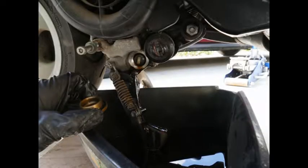Next, changing the tires. While the front tire is pretty easy to take off, the rear tire requires dropping the exhaust, and removing the exhaust is a minor nightmare. It's very hard to access the 10mm nuts — it's very easy for them to drop down and fall into the bodywork. Most people won't have an extension, a universal, and a 10mm deep socket. It's also easy to strip the copper nuts, and they're not a standard metric thread pitch, so you really need to have an extra set on hand from the dealer.